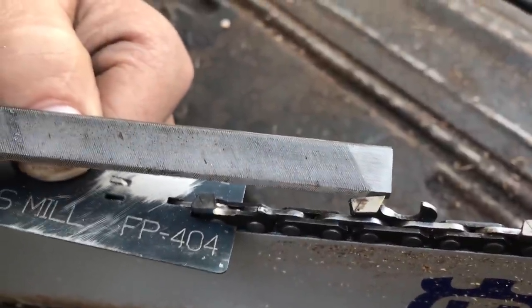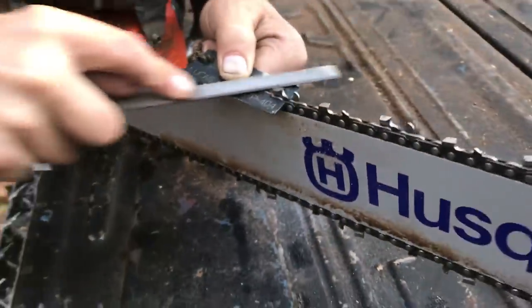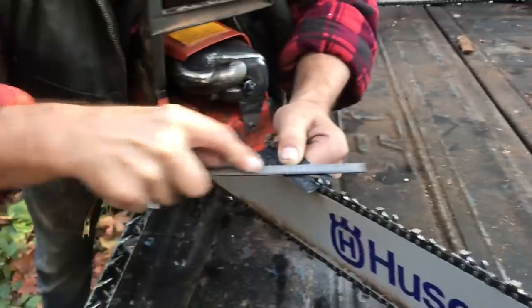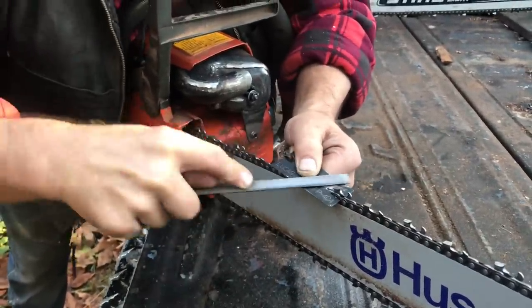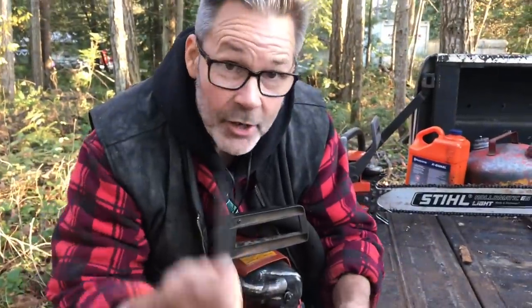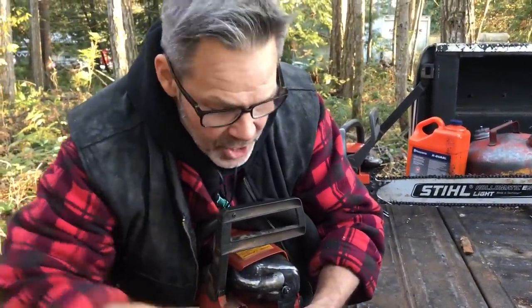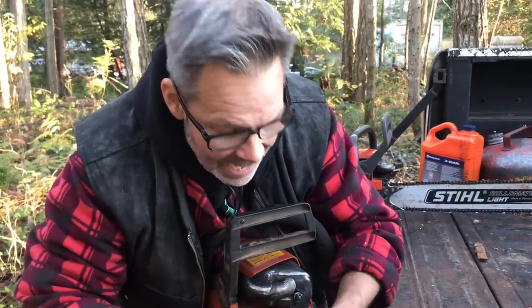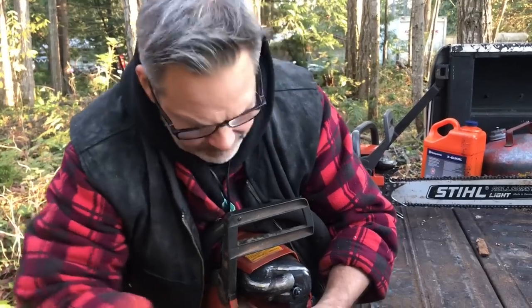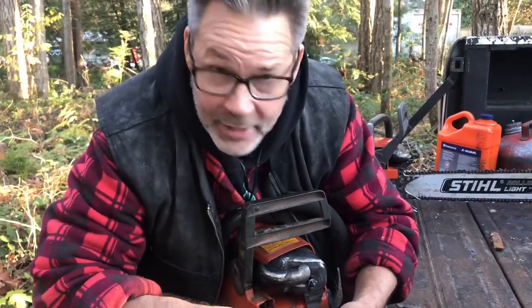It's way bigger. So, friends, the raker gauge is your friend. You want to go freehand? You just keep jackhammering that wood. Get on a raker gauge. I'm telling you, your whole game will smooth out. You don't have to make your teeth the same size. No one I've ever met has ever done that. No one had even talked about it until I came to YouTube. It's not even a thing, friends.